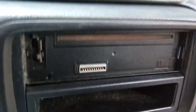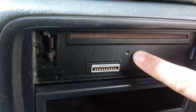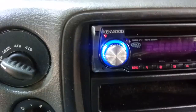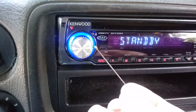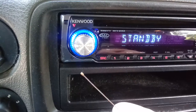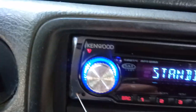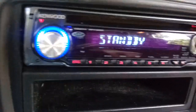Once you remove the face plate you can look on there and see there's sort of an indentation where the reset pinhole might be, or there's a hole in there where it might be — but it wasn't behind the face plate on my model. On my model the reset pinhole was right down here in the corner. You can take a paper clip, but I like to use a bobby pin because it has a blunt tip that won't damage anything. Just spread the bobby pin apart, insert it in the hole, push it for a second, and it'll reset and clear that code.